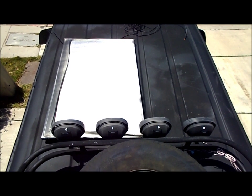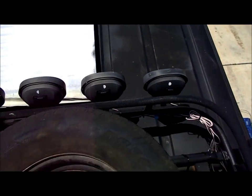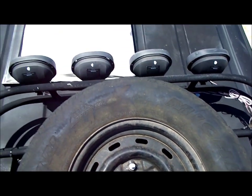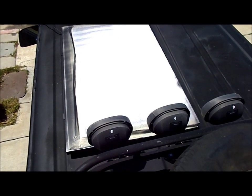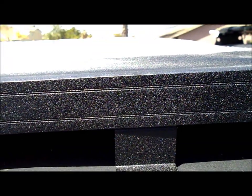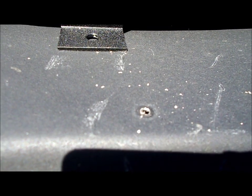I'm going to mount the solar panel offset on the driver's side so that I have room on the other side to put the spare tire on if I get a flat. The spare tire goes on the roof rack, so I need that space. I'm going to drill the solar panel offset on this side right now. The holes are drilled into the roof. Before I put the panel on the roof, I went ahead and painted the frame black to match the van. I'm going to put gasket maker around the mounting holes so hopefully it won't leak.